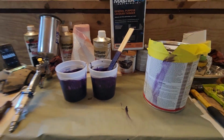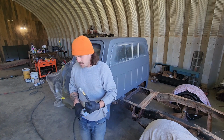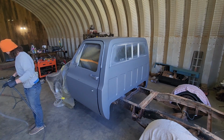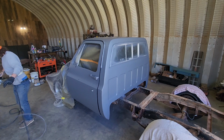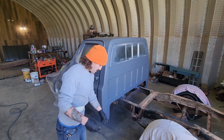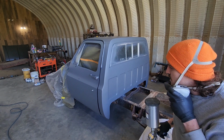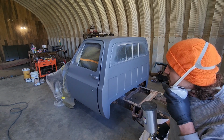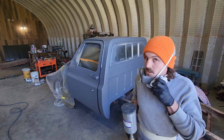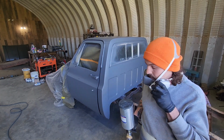Yeah. Yes. Got my belly strapped so it doesn't hit the paint. Wipe off the hose one more time. Try to negate some of the trash. Wasn't too much in the primer. What I'm essentially doing is using the epoxy primer as a sealer, and I think I'm gonna spray the first coat super light, try to fill in some of those bullseyes, and I think it'll turn out pretty good.